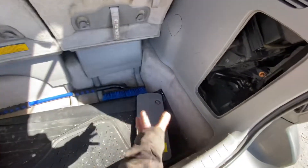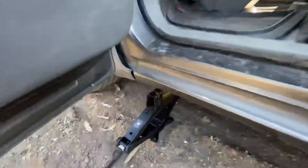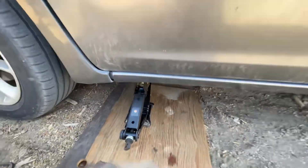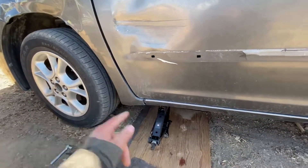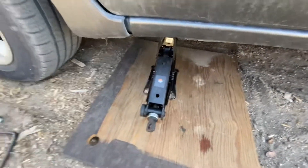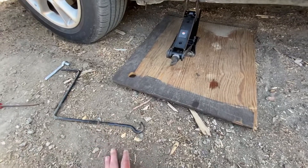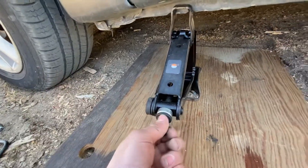This is where the jack is — you just remove this panel and the jack comes out. The way to jack them up is you line it up with those two notches, then jack up your vehicle to change your tire. I'll put a link in the description to a YouTube video on how to jack up your Toyota Sienna correctly with the stock jack and get the replacement spare tire. Always when working outside, like myself — I don't have a garage so I work out in the dirt — put something underneath so it doesn't slip on loose dirt.